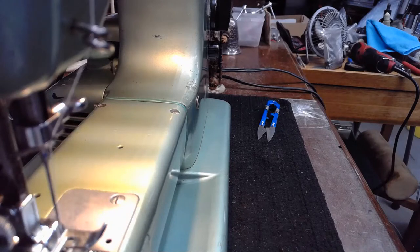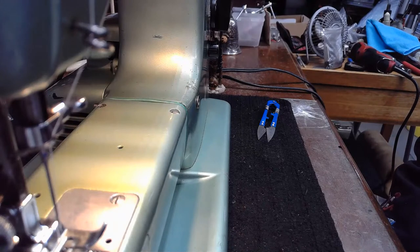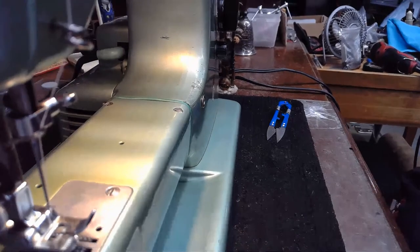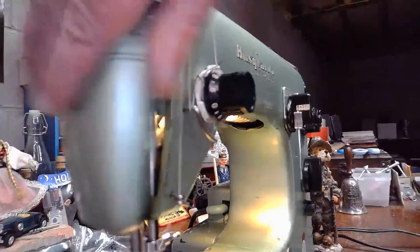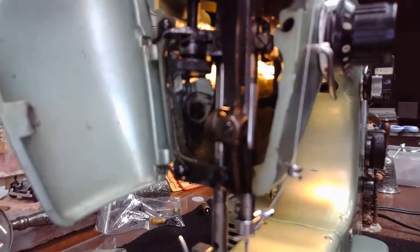Oh, very cool. AW did a little bit of extra credit for the classroom, and he said when we're on 4, we're getting the result of about 7 stitches per inch. 7 stitches per inch. And that varies depending on the material you're using. Also, it varies as well based on where you have the presser foot pressure in here set.